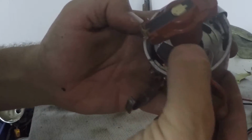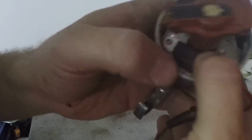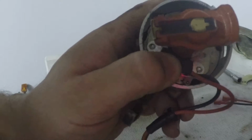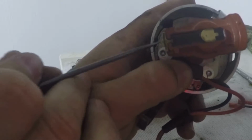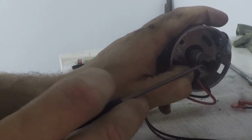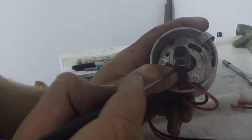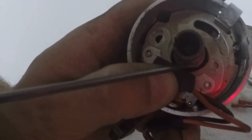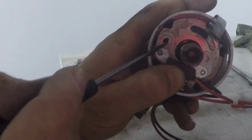with the rotor on. If I turn this, okay, the hash mark is here. You can see it, hash mark 009, lined up with the rotor itself. Now if I keep holding down the unit and I pull the rotor off, like we were before, remember there's your notch here that lines up with the rotor, and the bump that we were talking about back in the first video was lined directly up with the unit itself. The bump and the unit together. So what I'm going to do is leave this hole here as my adjustment hole.